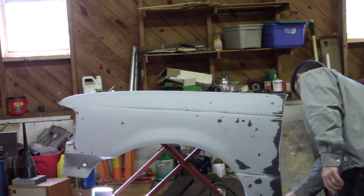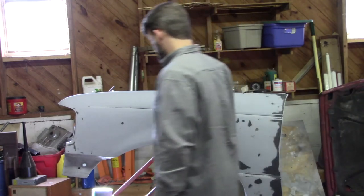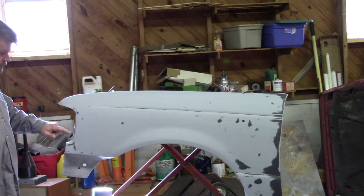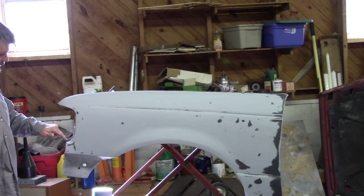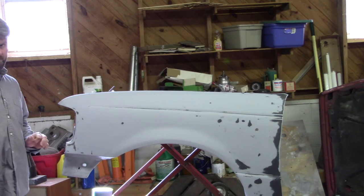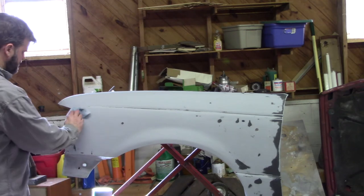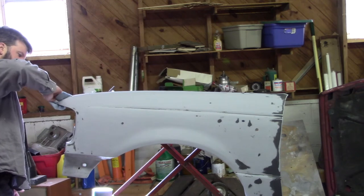And what that means is, say I get the fender on and I don't pay attention to this edge, and it doesn't get a good prep job or paint, either one. You could miss it in either step, and you will absolutely be able to see it in the finished final job. So be sure you pay attention to those. Sand them all good. Wipe them all clean.